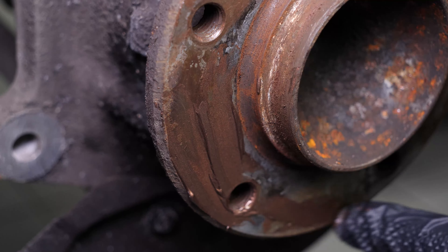All parts used in this tutorial are supplied by our trusted partners. These partners also help us create as many video tutorials as possible. Check them out in the description below — you will find the bulk parts and products used in the video on the Mr. Auto site. Take your new brake rotor. Before installing the new disc, it is vital to clean it using brake cleaner and paper towels to take off the storage paraffin. If your new disc is painted, you can place it directly onto the wheel hub.